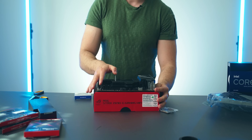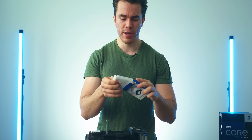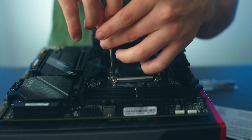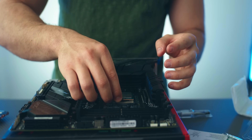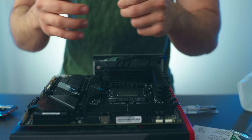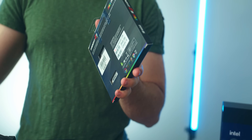This PC build is going to be something else. We've got this contact plate because Alder Lake has pretty poor heat dissipation when it comes to how the socket bracket is attached to the CPU — that's why we're replacing the stock bracket with this. Here's our torque wrench. Let me unscrew this so you can see it. Drop this in very gently, give a little jiggle — that is in. Now let's put on the contact plate. One of the best processors Intel has ever made, and I'm never going to see the name of it ever again — at least I have the box as memorabilia.